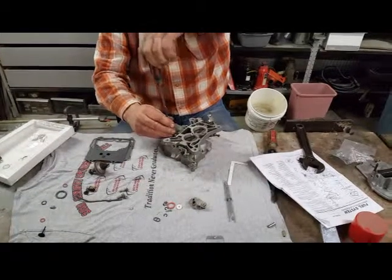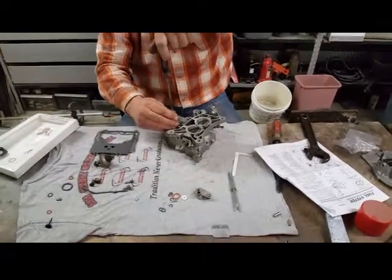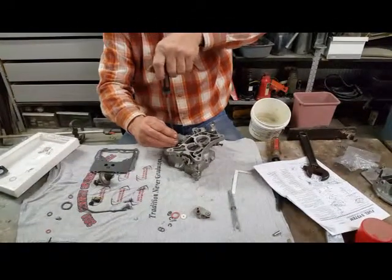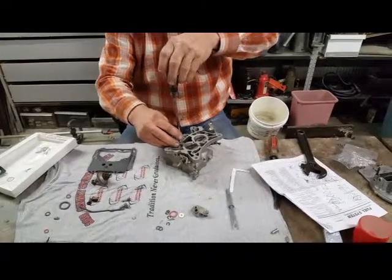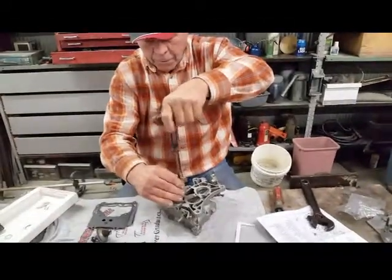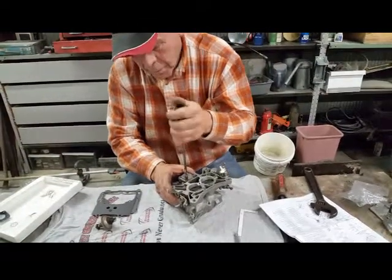As the motor gets a high vacuum, it's not working as hard, right? High vacuum is usually where you want your motor. That's where you set your timing, and where you set the balance of your carburetors and your air jets: at high vacuum.